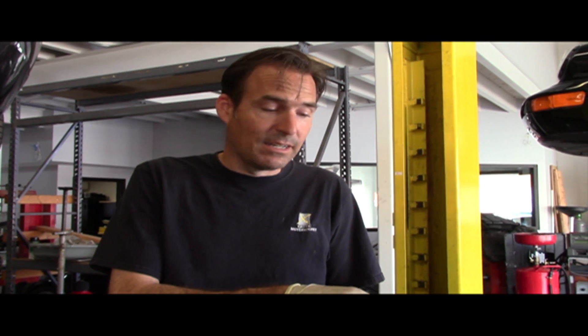So we're done charging the AC on this 928. It blows nice and cold and everything's working good. This is a classic example of what happens to a lot of these older cars when they get in the hands of mechanics that aren't familiar with them. This customer originally took this car to another shop and they told him he needed an AC compressor and an expansion valve. What we found when we got into it — the threads were a little bit messed up on the low side AC service port. We went ahead and cleaned those threads up, got the hose on, got the readings we expected to see, and were able to evacuate and recharge the system without the need for a new compressor and expansion valve.